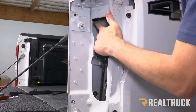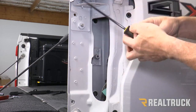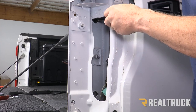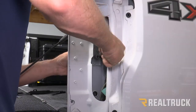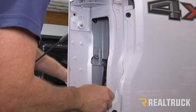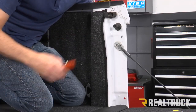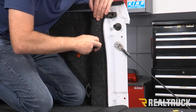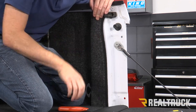These are the three holes we will be working with. Because this truck has a bed rug, I'm going to take a pick tool and push a hole right through the center of the bed rug through each of these holes. On the opposite side where we just made the holes, I'm going to take a razor knife and just make a little X-mark, so the hardware can go right through the hole easily.